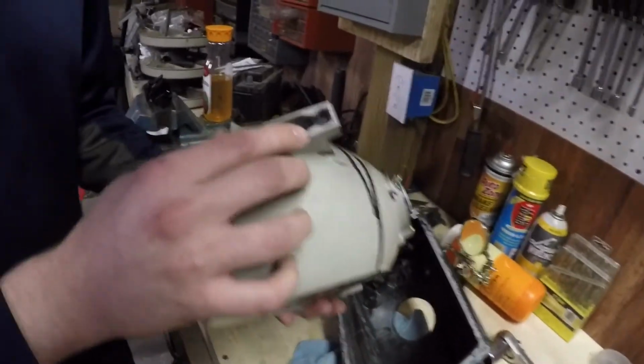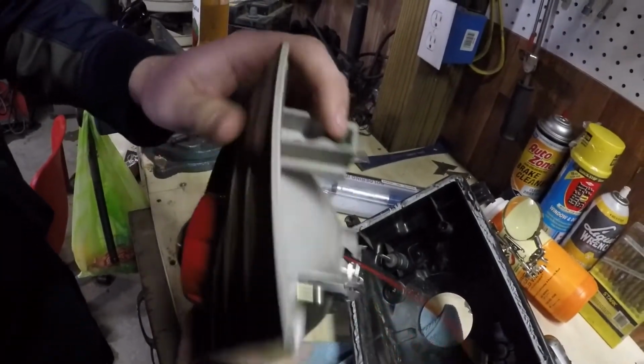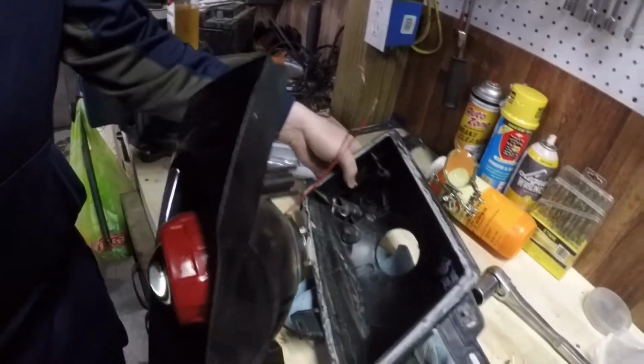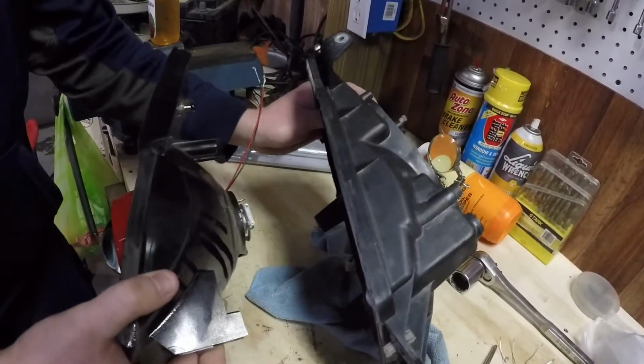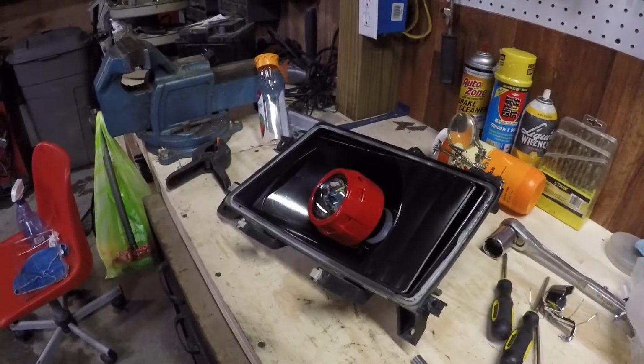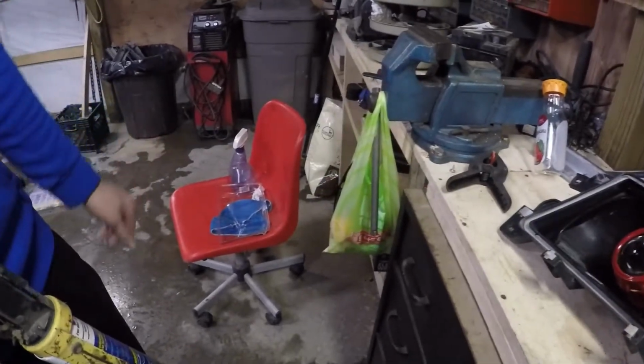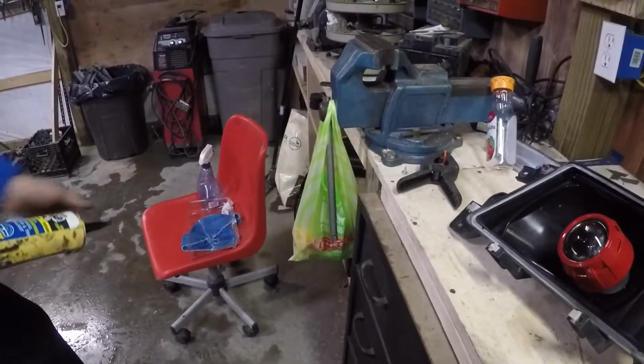and also there's clips here and here that the headlight adjustment screws, which actually hold the reflector in the headlight assembly, will screw into. With everything reassembled, this is your last chance to clean anything inside or inside the lens, and we're just going to lay down some silicone to reattach the lens to the housing.